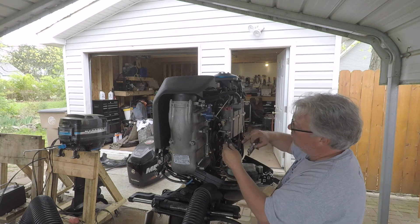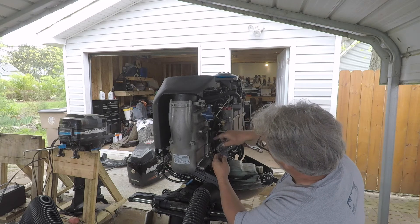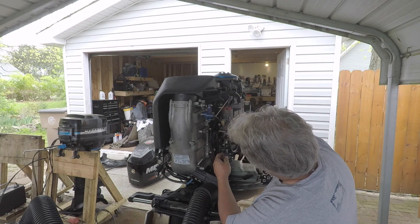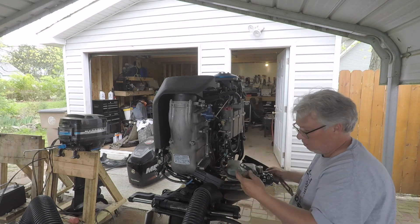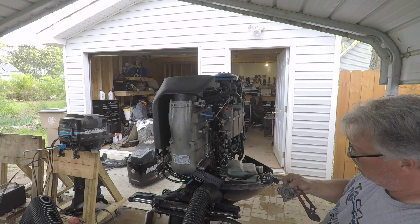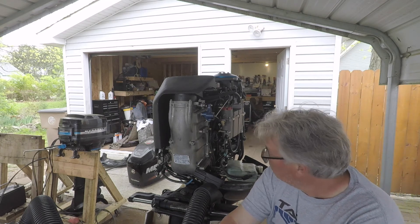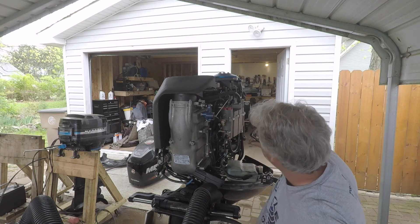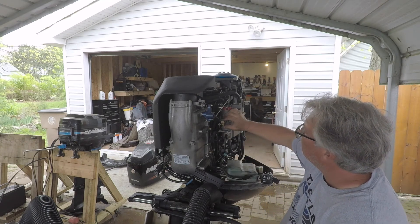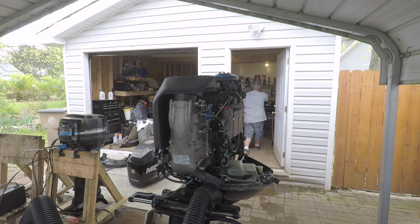This thing ended up actually fixing my problem. What was happening is the pump wasn't pumping enough fuel into the VST to keep up. It seemed like it started to miss after you would do a run — you'd come back down to idle and then have a slight miss — most likely because it just couldn't keep up with the amount of fuel flow the VST needed. You could put a meter and check your pressure and it would probably never show you that it was weak or had failed.